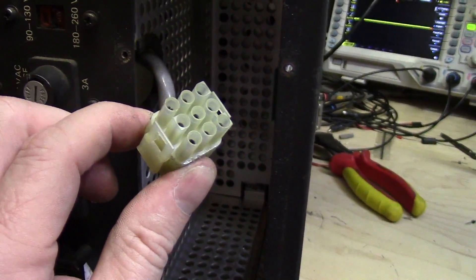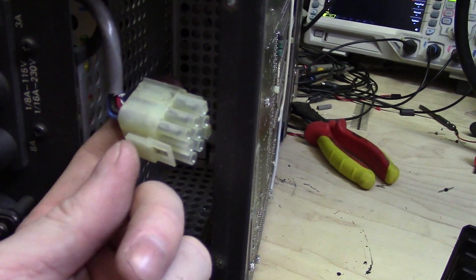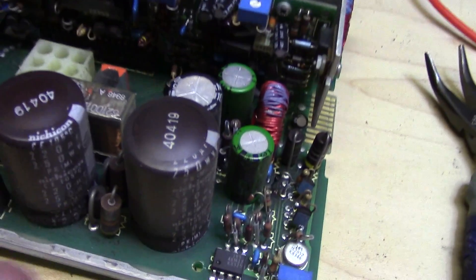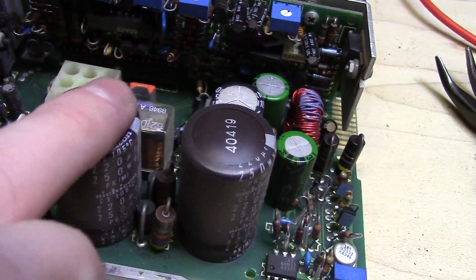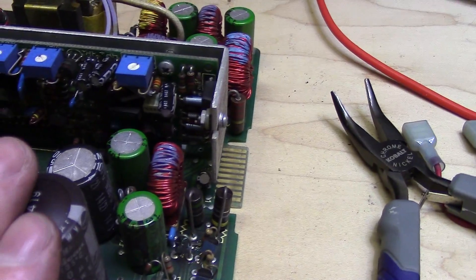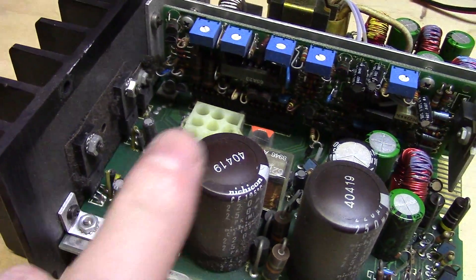I've got the power supply removed. The easiest way to disconnect it is to work your hands in and get the clips disconnected, then come in with a flat blade screwdriver right in the crease — don't put a lot of pressure, just easily start wiggling in and out with some outward pressure. I have not tested these yet, but as you can see these caps don't look good. I see a little bit where they've actually leaked out, and they've got fat tops kind of squeezed out. More than likely these will need to be replaced. This failure could have caused more damage on the power supply. I've actually got the service manual and we'll go over the schematic and the testing of the power supply.